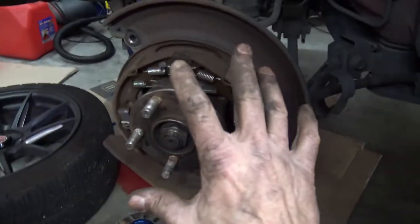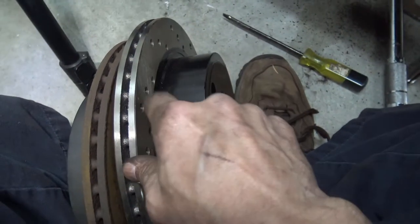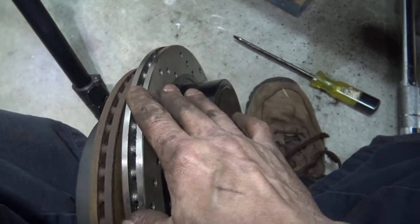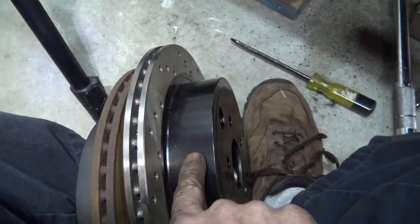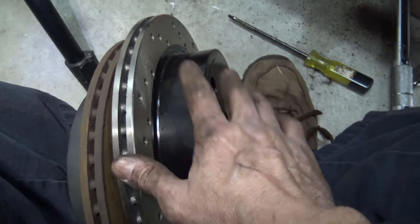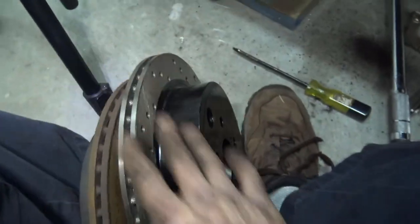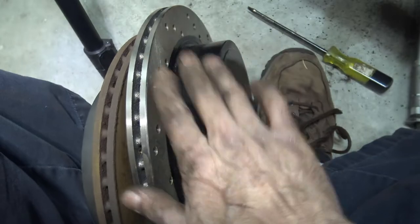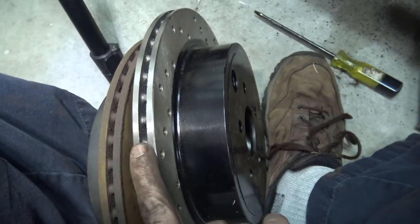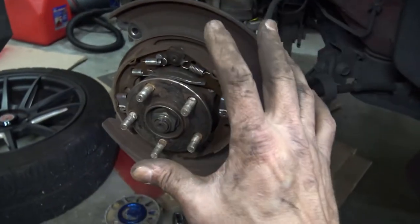It's always good to have lightweight — you want to take weight off your wheels if you can. But brake rotors absorb the heat from the brake pads to help stop the car. The more metal you have, the more heat it can absorb before it gets to an overheating condition. This rotor may not accept as much heat, and therefore the brakes might overheat a little bit earlier — whether or not that affects daily driving or just the track, I'm going to find out.